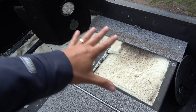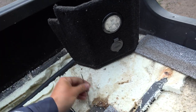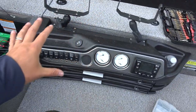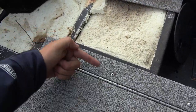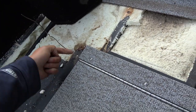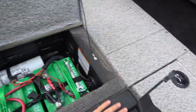Starting out in the back, I basically removed this big panel. I'm going to stick the lights on last, but I wanted to get some routing figured out — how I'm going to get power from over there all the way to my console over here. We have the splash well back here, and between the splash well and the live well there's a space. I ran a drill bit down through this space and I was able to put a clothes hanger down through here and it comes out perfectly right down in here.